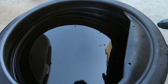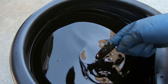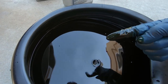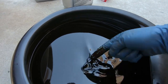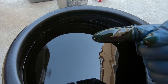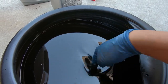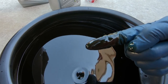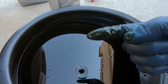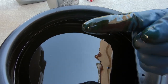Now that we've got all the old oil out of the car, we can take a look and see if there are any signs of issues for the engine. Any type of water in here could mean a blown or leaky head gasket; metal shavings could be signs of bearing issues. But in general, your oil should look more or less like this — not very clumpy at all. Dirty is fine. You can see how dark my engine oil is — dirty is fine, slightly warm to the touch, no metal shavings. It's relatively just dirty old oil.